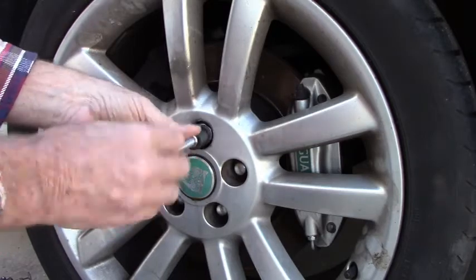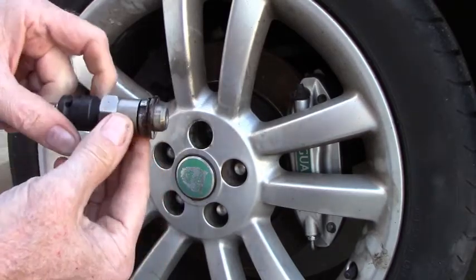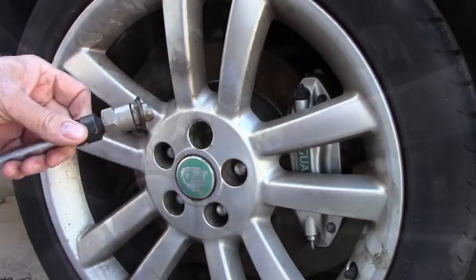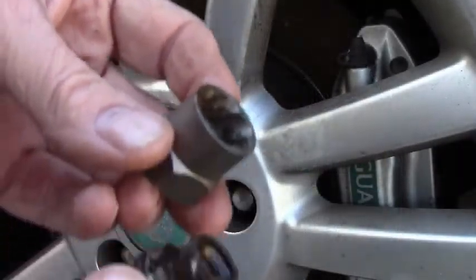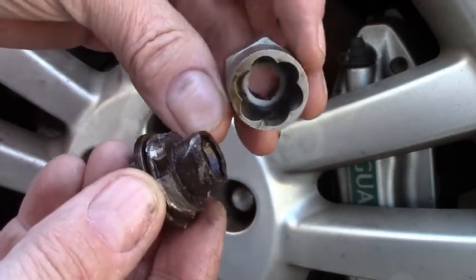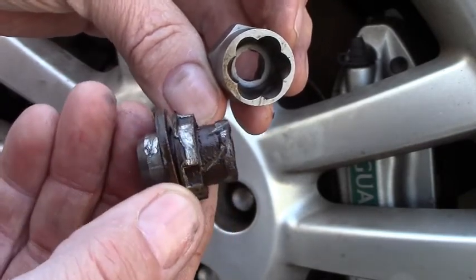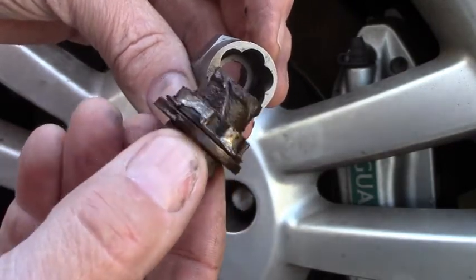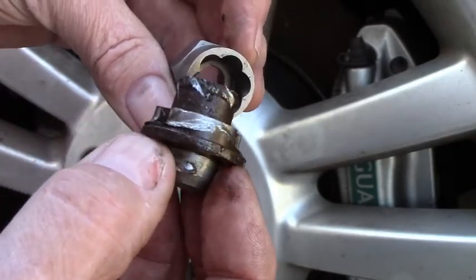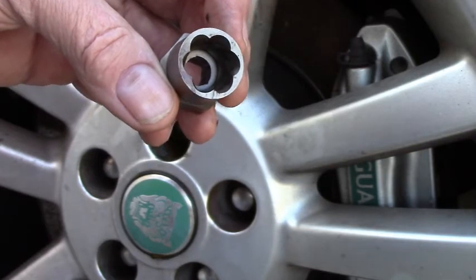And I believe I got it. Hallelujah. What a mess. So that worked just dandy. You can see that this thing has got reverse grooves in it, and it gripped the end of the lug nut, and you can see the condition of the lug nut from using an impact wrench on there and the locking key. It just totally stripped it out. So that's the answer. Thanks for watching.